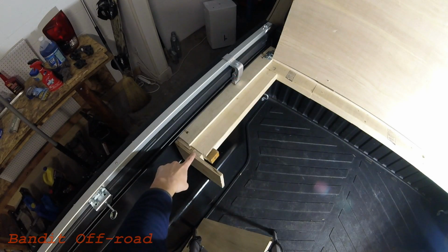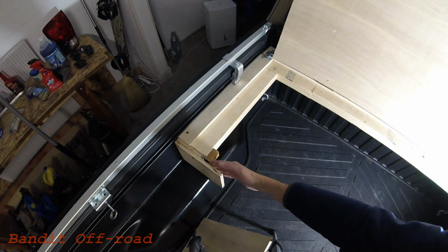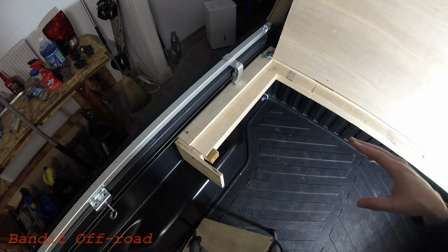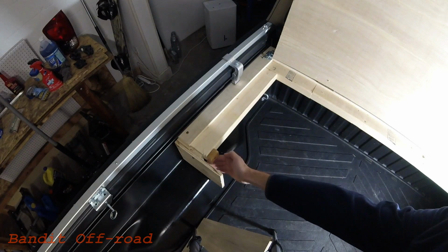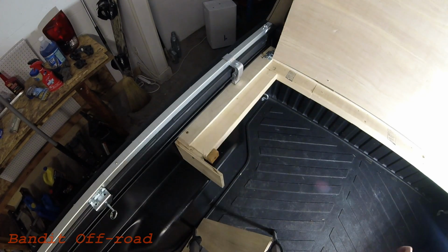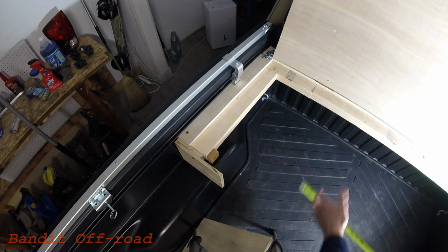Also here you can see where the front door lives. I just brought this out by a width of plywood and then made this big block off plate here on the front. The front door slides down in this gap, and then it can't rattle around because you have this front block off plate. I did add this small block here in the rear that you can see is stained. I added that just to keep everything a little bit tighter. All of this is just squared off, so obviously here in the back, this front door doesn't fill up all that space, but the corner does come up all the way and match up to this, and that is just about 4 7/8 away from this bedside.